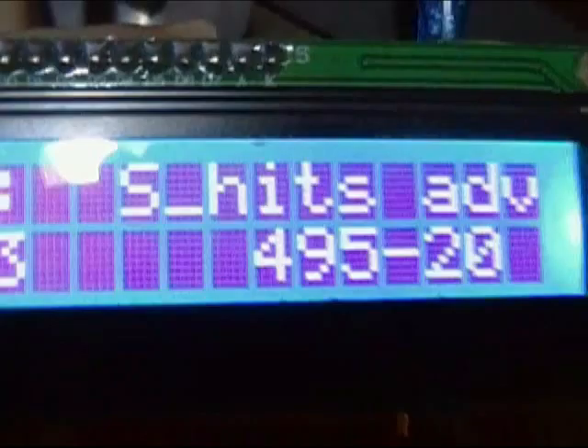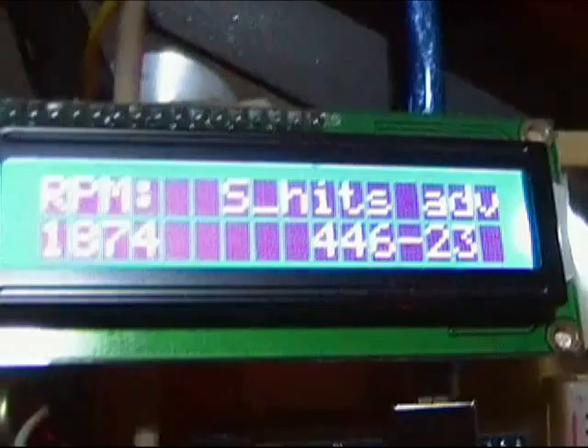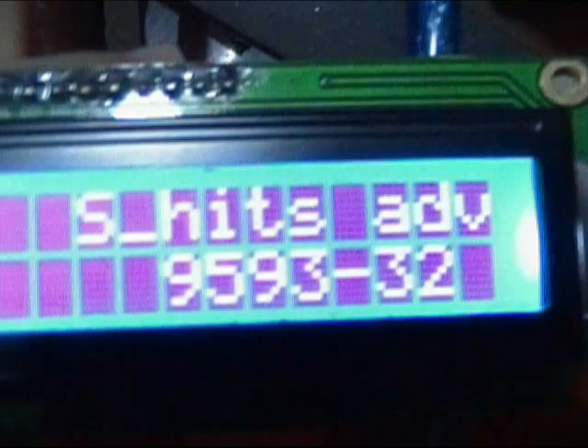I have coded in a range of TDC to 60 degrees advance. One Arduino Uno is sensing TDC from a Hall Effect sensor that reads a magnet wheel. It determines the amount of time it takes for the crank to move one degree and uses that information to schedule sparks using a four-wire Toyota coil near plug pack. A potentiometer allows setting the timing anywhere within the selected range of TDC to 60 degrees advance.